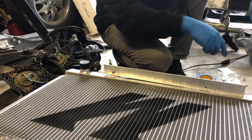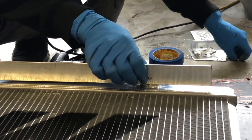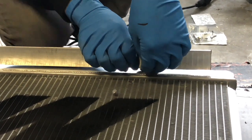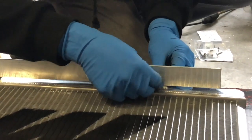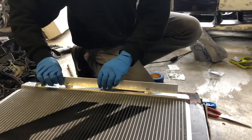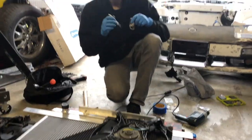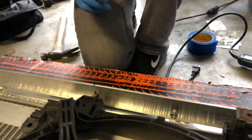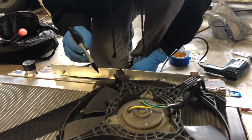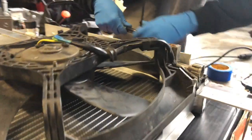This is just for the time being — we still have to take it off and drill. We have lock washers for the top. It's so nerve-wracking trying not to bend fins. Nice and sturdy. And put a piece of aluminum down to gap the radiator — we're gonna eyeball this. We don't want to touch the radiator, but we still want a good airtight seal so these fans can pull. So we marked it there and we're gonna drill and see what it looks like.